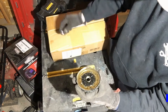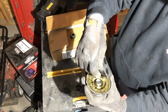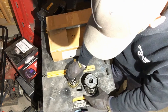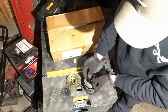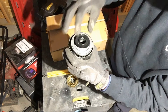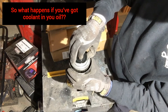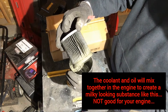There is a rubber valve here — this valve is just rubber and it opens up to let oil go through the outside of the filter. So this will sit like that, and the oil will go out the outside of the filter, then it filters through and comes out the middle into your engine. So when you have too much coolant, all that stuff gets trapped on the outside of the filter.